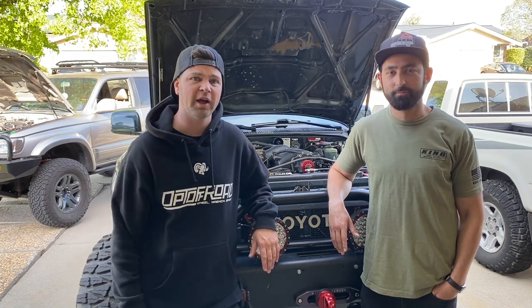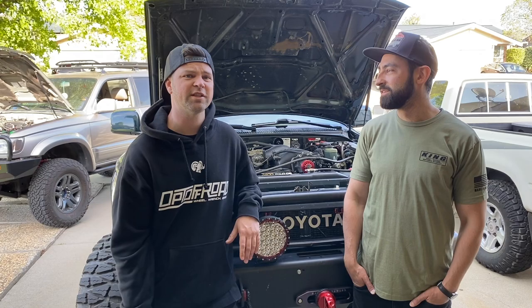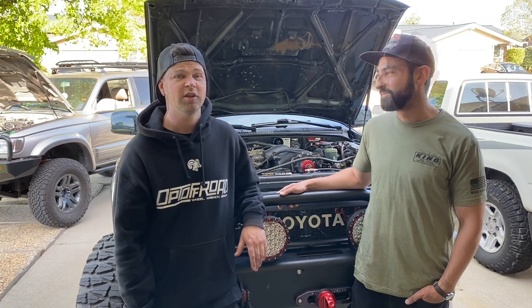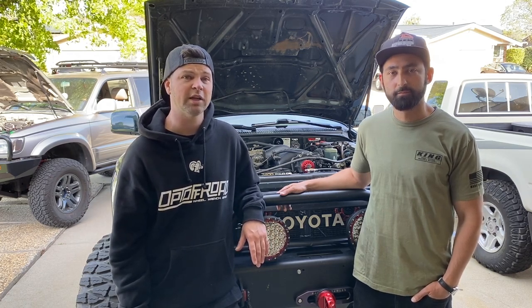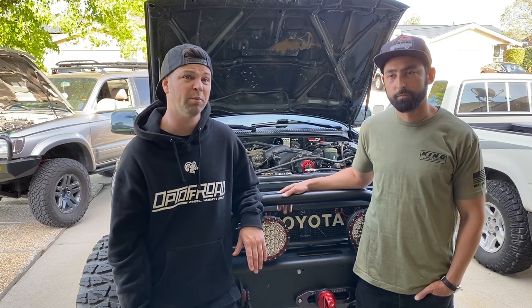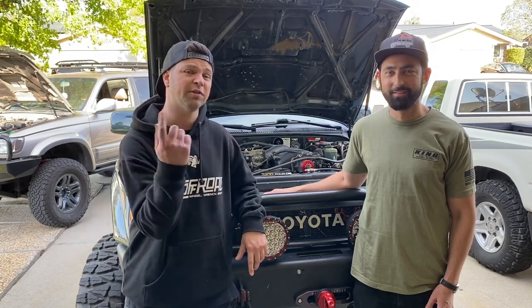We filled the supercharger nose cone with supercharger oil and slapped both superchargers back on top of our engines. It's been a couple of months now and everything is running smoothly. As you saw in the video, be mindful of which style of housing you have — if you have Stevo's style, you'll need the blind bearing puller for one of those bearings; if you have my style, you can just press them through. My supercharger was getting noisy, and after replacing the rear needle bearings it's as quiet as a mouse — almost sounds like a stock truck at idle. Stevo's also got quieter. This was a pretty successful job — leave questions and comments below, take care, and we'll see you in the next one for some more sick mods.